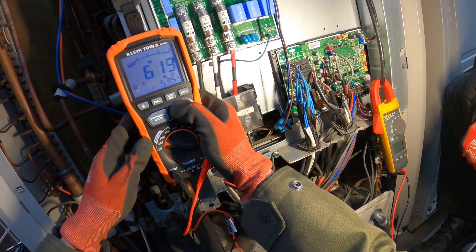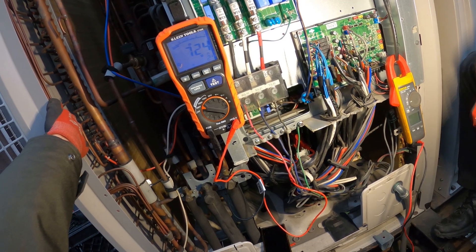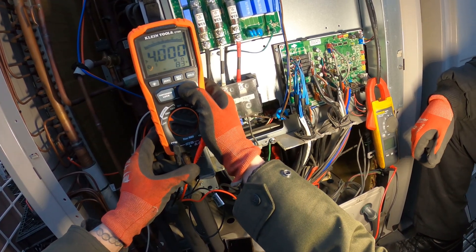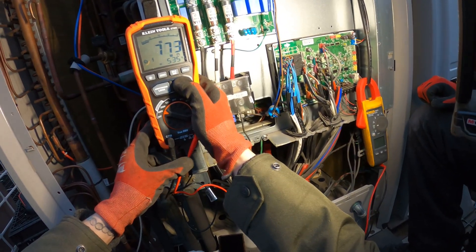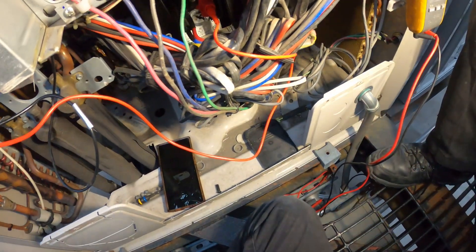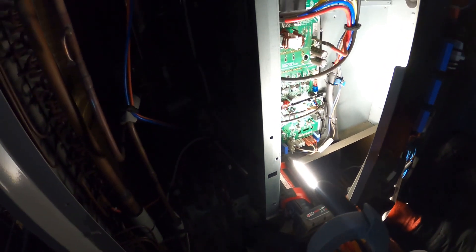Why'd it go down there? That's a much lower reading — 724 mega-ohms. All right, last one: oh, that started off low. Yeah, those are pretty low readings compared to the other. It started off real low. It checks out, but it's on its way out. It's nighttime already — compressor's on its way out, inverter board is bad.